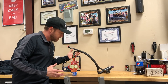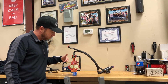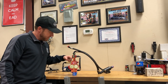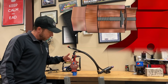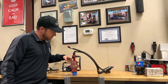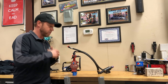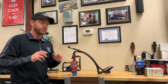What's pretty common is this check valve right here, called a pump loop. A lot of guys will take this pump loop and put the outlet in the bottom of the fuel pump, like we do — others put it directly back in the tank. There's a jet in here and a pressure spring. At a certain pressure preset by the tuner or crew chief, this opens up through an orifice — what we call a jet, an early main jet — and it allows the fuel pump to flow fuel from the pressurized side back to the inlet. At the heart of its design, a mechanical fuel injection system is a series of leaks: a pressure pump and then a series of leaks, whether in the engine, back to the tank, idle check valves, port checks, or the supercharger.